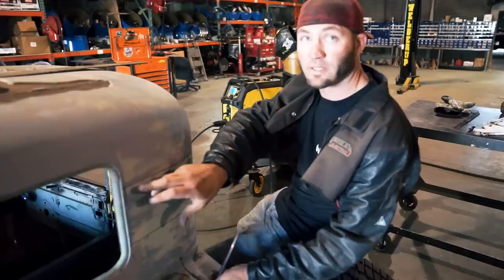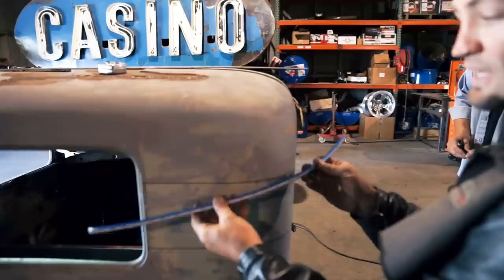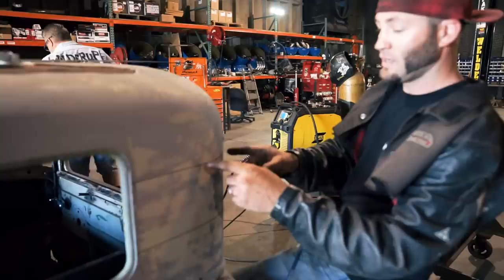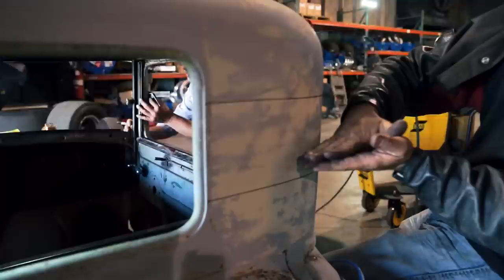Curve. So you think it's easy, you do. We did 6 inches here on this window, and we came over and marked 6 inches on this window. But if you're doing it with tape or something like this, when you go line to line, draw your first line, but when you go to do your second one, the center of this could be bowed a little bit, especially when you use tape. So make sure you come off this line and you find the center and make another 6-inch mark. That way, when you make your second line, even if this one is bowed a little bit, if you make that center line, this one will follow. So that way, when you cut it out, it's all gonna fit nice together and it's not gonna open up to a gap.